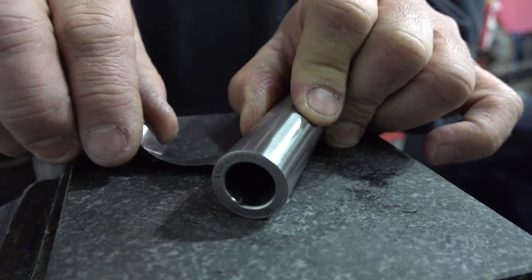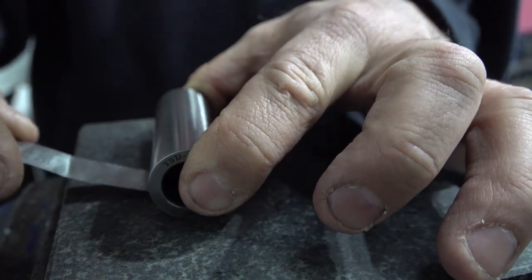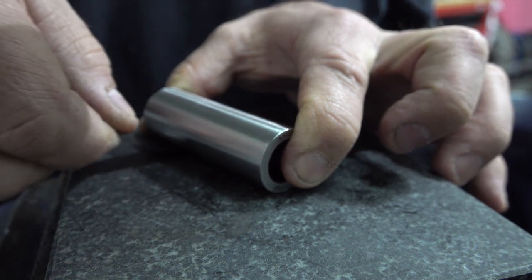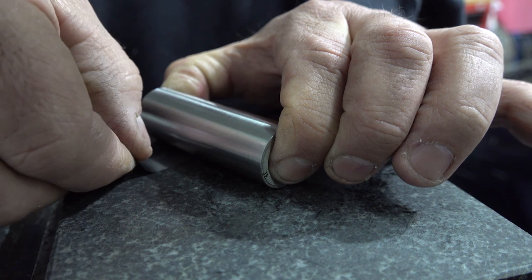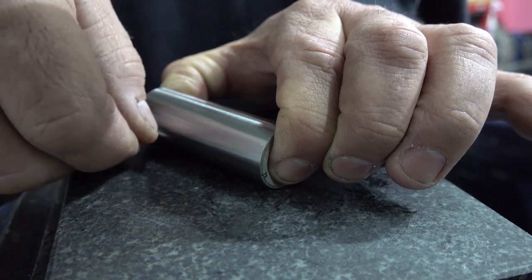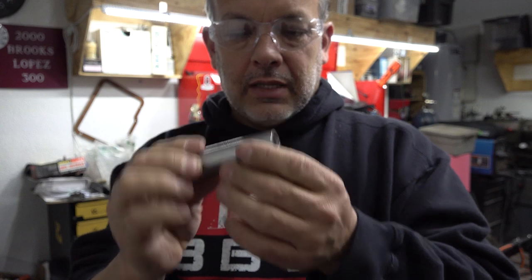I'm holding pressure down on the wrist pin. I'm going to move it to a different area of the surface plate just to make sure the problem doesn't exist in the surface plate itself. It looks like — yeah, see it — it goes under there out here by the end. I'm really not satisfied with those results. That's bad — for a wrist pin to be bent a thousandth and a half in that short distance on a really thick wrist pin, that's really bad news.